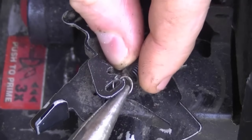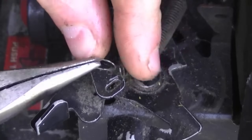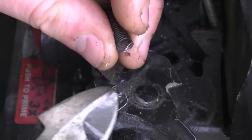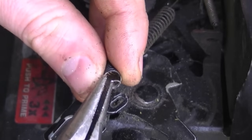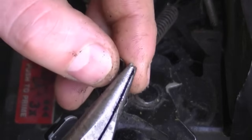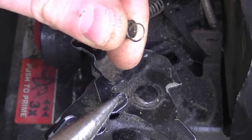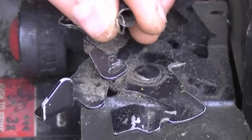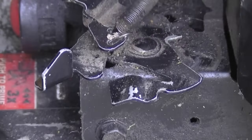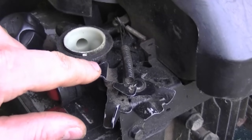I'm going to disconnect the spring here, just loop it around that hook. Now I'm just going to snip it off here. You can see that the loop's gone. Now I'm going to grab it with some needle-nose pliers and create another loop — just like that. You want to make sure that the loop's big enough so when it's hooked back in it doesn't come out. And now I'm simply going to re-hook it inside the groove here. This has made the spring slightly tighter so we should be getting a bit more RPMs.